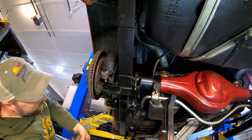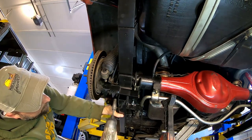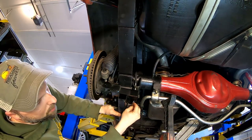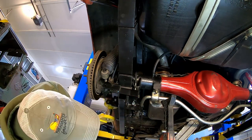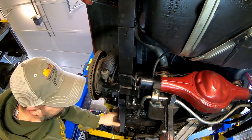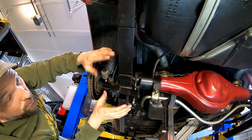These are 11/16-inch size nuts. I've got to gently convince everything into alignment here and tighten that up. The traction bar has its own set of instructions for prepping the amount of play — since it's a street car, we're not going to have it snubbed up tight all the time. I'll work on that in a little bit. Obviously I've got to connect the shocks and a few more things to go.